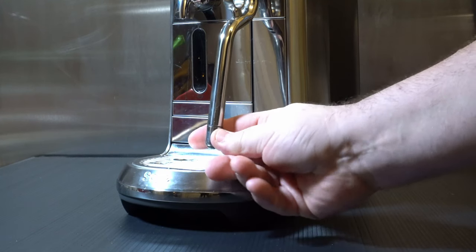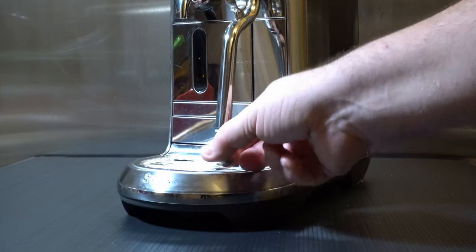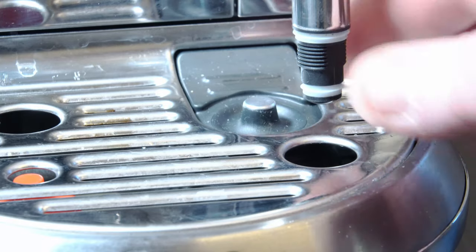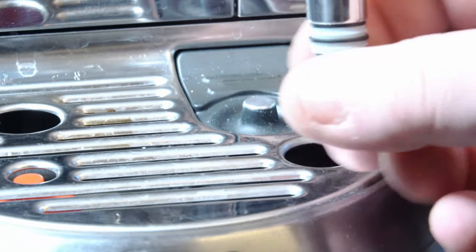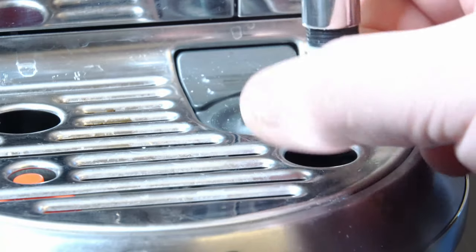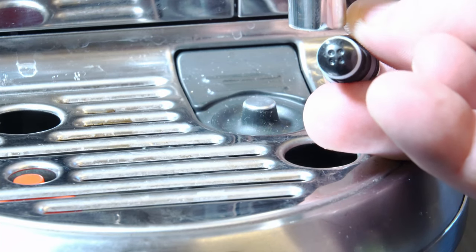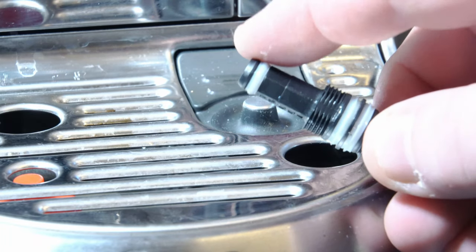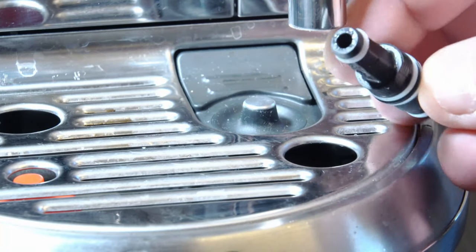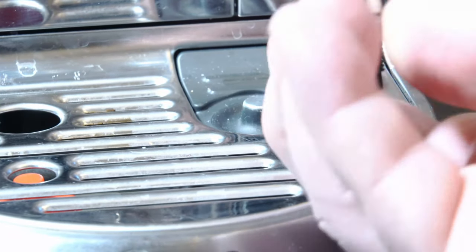And the key thing is you have to undo the nozzle, which can be a little difficult, I have to say. There we go. Undo the nozzle. The nozzle's in two parts, the chrome outer bit and the plastic inner bit. As you can see, there's the very small pieces here, and then you clean them with the tool by pressing into each one. I would say it's worth cleaning them in hot water as well, because sometimes there's blockage in here. Now the plastic inner piece has two O-rings really, one black one in the middle and one white one here. Both need cleaning to make sure they seal properly, and then this just goes back into here